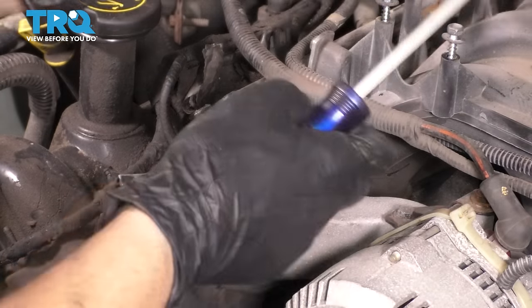Can sit right there. Through the passenger side wheel well, I'm taking the passenger side out, but the same applies to the driver's side. I'm gonna disconnect the bolts from the manifold to the rest of the exhaust first. And for me, they are 15 millimeter nuts. Hopefully they come out. If not, I'll have to just cut them. This one came off the nice way. Now you can grab your tool of choice and get this collar off of here. Okay, well, looks like I got this thing stuck on here, but I'll fix it later.